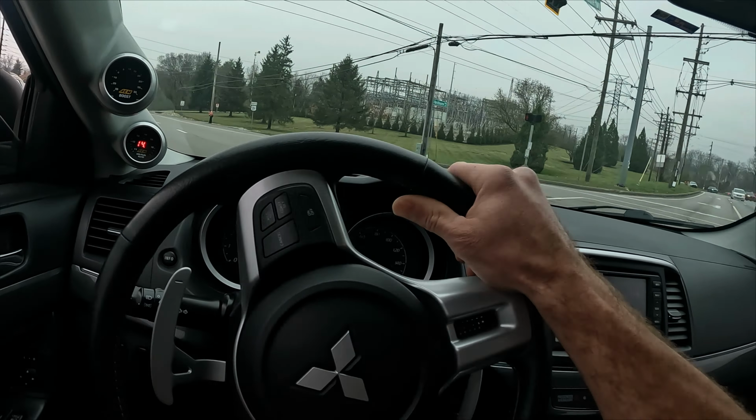You can also see on these, you can toggle between, I think you can do it while you're driving, tarmac, snow, and gravel. So these do have the traction control options found on the Evo. It has the active center diff as on the Evo X. It just does not have the active yaw control, or AYC, differential in the rear. It has a simplified mechanical limited slip differential, similar to that one on the Evo 9 and earlier. I'm acting like I'm an expert, I'm really not. But yeah, you can see tarmac, gravel, snow. I guess I'm on tarmac.